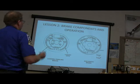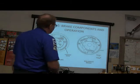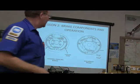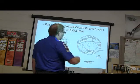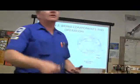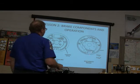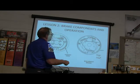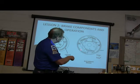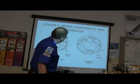Now these right here. Look at your question on your test, you guys. Leading trailing brakes are the ones that you usually see on the back of a front wheel drive vehicle. And duo servo brakes are the ones like we got on the stand out here that you're usually going to see on the back of a rear-wheel drive vehicle, like the Bronco out there has got duo servo brakes. On the duo servo brake, the front shoe has got the short lining. The front shoe moves around and energizes the rear shoe, which has got the long lining. It goes against that post and it does most of the stopping.